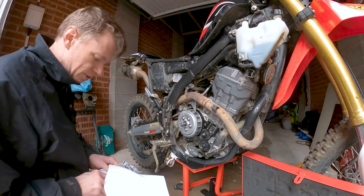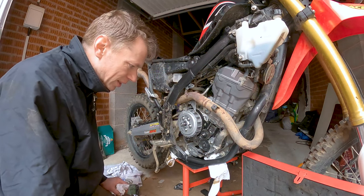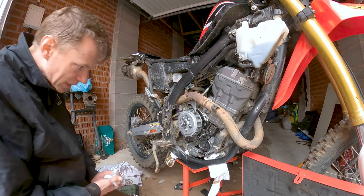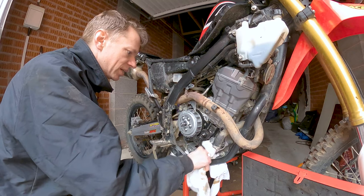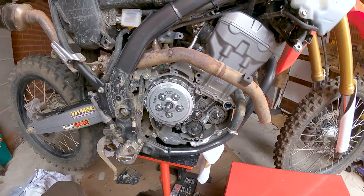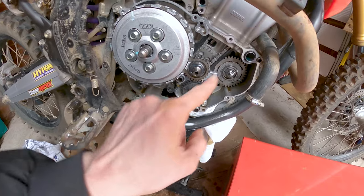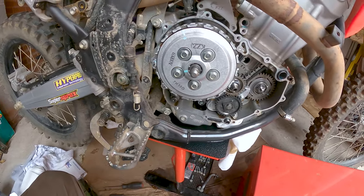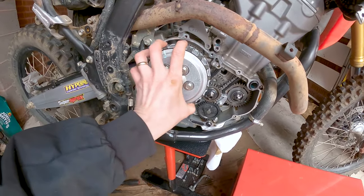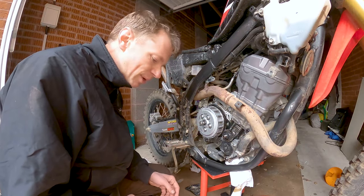This stuff is an absolute lifesaver when doing a job like this. Worth noting — if you had the bike on the side stand you probably wouldn't have to deal with excess oil, as it would drain away, but since I've got it upright I have to deal with the tiny bits of oil. There's the engine without the case on it — be real careful because there are a couple of little O-rings around here that have started to come away. I've had to put those back and will clean them when I refit. Right here is our clutch basket.